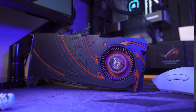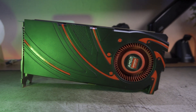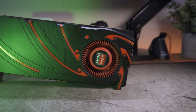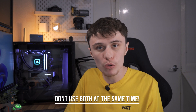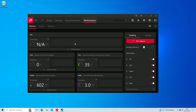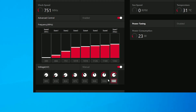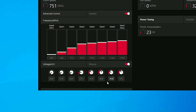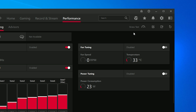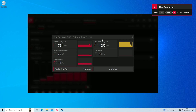With AMD graphics cards you have two options: you can either use MSI Afterburner or alternatively the Radeon software. Today I'll be using the Radeon software — but do be warned, don't use both at the same time; use one or the other. Go to Performance, then Tuning, and enable both manual control and voltage control. Lower the voltage to your desired voltage and click Apply. In the AMD Radeon software there's also a built-in stress test you can use as well, which is great.